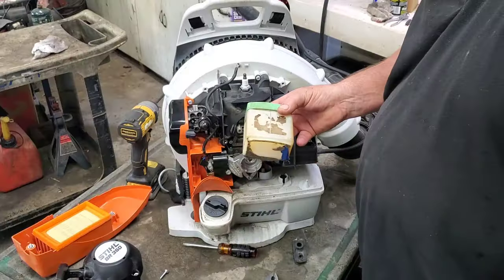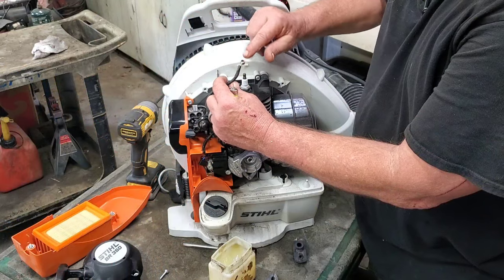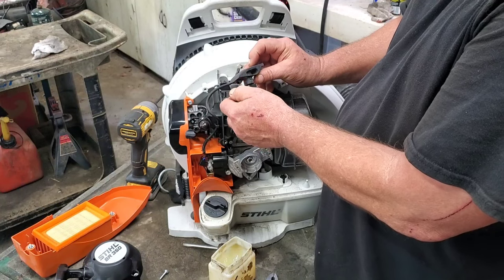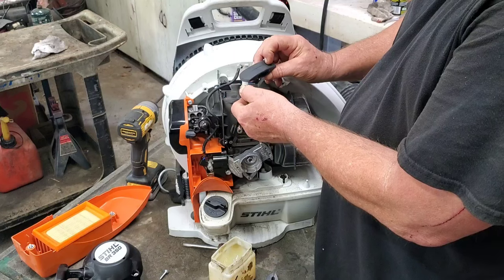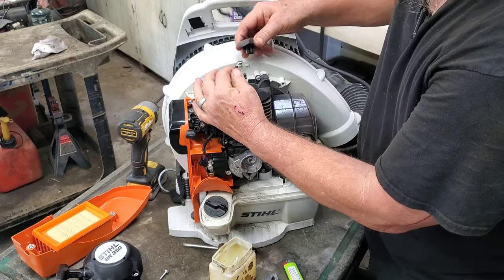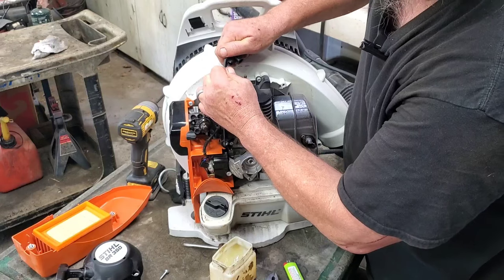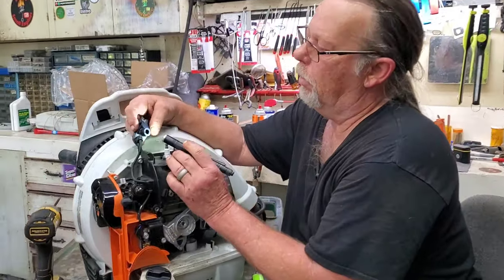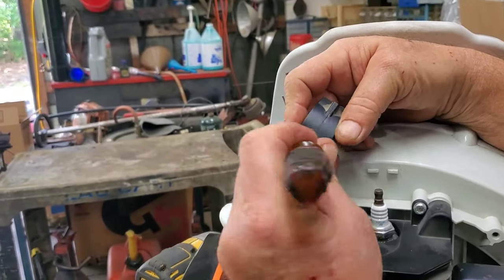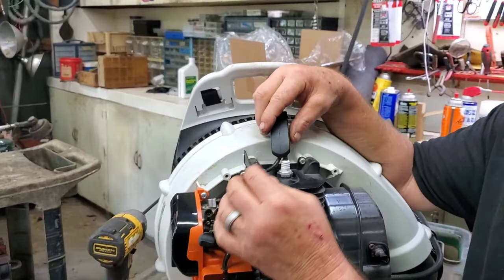Let me show you my other trick. You can use grease or whatever. Just a little lube on this thing — it'll help this boot slide on. The other thing I'll do is warm this up a little bit. Don't go crazy — you can use a heat gun, or go steal your wife's hair dryer. Warm that up a little bit and go a little bit around the edge of this, then just hold it tight and slide it up in there. It's going to be hard and your fingers are going to be slick with grease. Come here and look — look down in there and make sure that that little spring piece is straight. If you need to, do a little tweakage with your screwdriver. You just want to make sure to go plug straight down onto your spark plug. And we just saved ourselves from buying a coil.